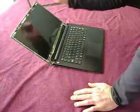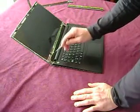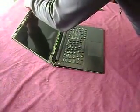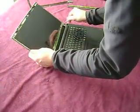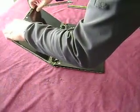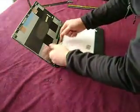Now there are four screws that hold the screen into place and there's a cable connecting onto the screen as well. First thing you do is take out all four screws. Just fold that screen down like that — don't fold too hard on the cable.